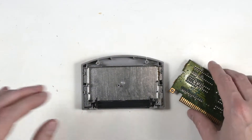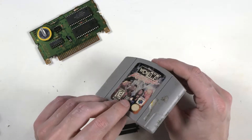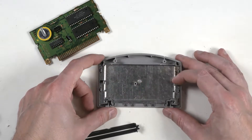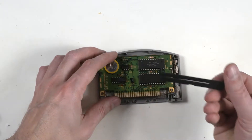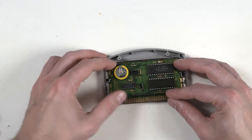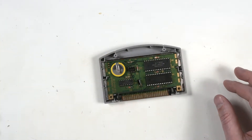Now we've got to put this thing back together. When you're taking stuff apart, don't be afraid to take pictures. You take the top of the cartridge and make sure that the shielding is in there. The shielding is unique — these little tabs will prevent you from putting things in wrong. Then you take the black part and put it over the card edge. If you did it right, things will just drop right in; if not, this black piece will keep it from fitting. I don't know why they had to make this cartridge so complicated.